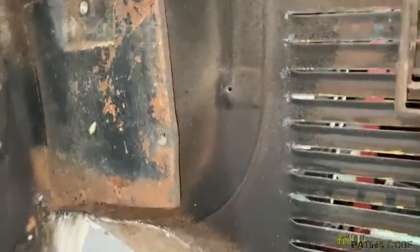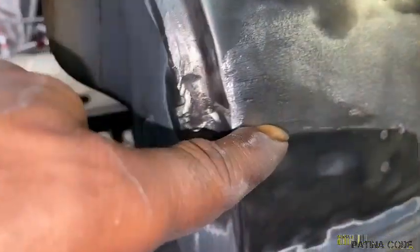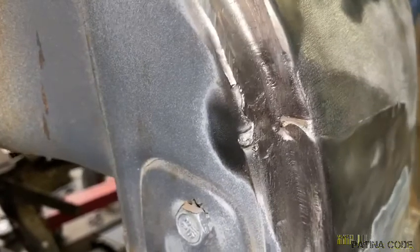And now it'll be time to release these panels. But we're not going to do that just yet. We have to get the seam broke away. We're gonna have to chisel because there's some lead fill right there. Right here, it's lead filled pretty deep, and then the seam would run all the way across. Man, that lead looks cool in there, but it's gotta go in order to get this off.